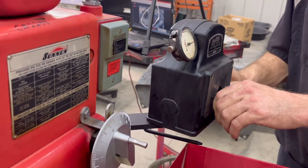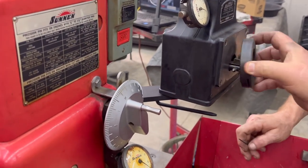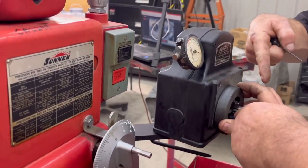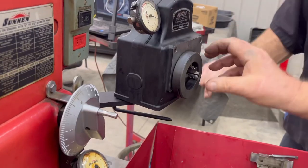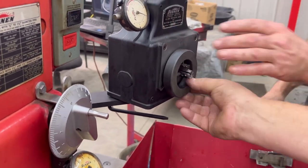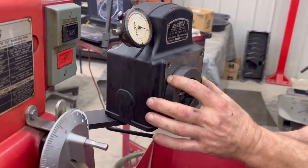So when you're working a gauge, you have to remember, I told you wrong, you don't push up. You put your gauge on there, you got to push against these two, because this is the one measuring. You always, while you're measuring, you got to be pushing down on those two. So, slots on the bottom, bring it up till you get a reading on your gauge, bring up your points.